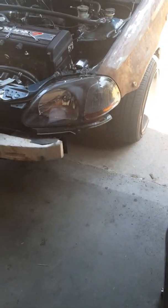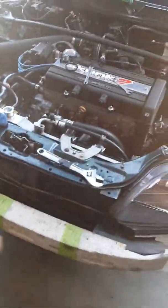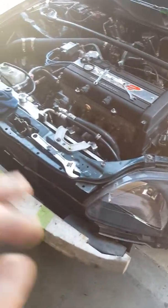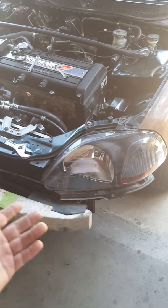So this car is in California — we have to have our cars BAR'd or do a hot smog. This car is actually BAR'd through California. They changed the laws a long time ago when they found out you can use all the B18B components from an LS for a B20. The trick is on 96 to 2000 — you have to use a crank position sensor, so you change to an OBD2 and up oil pump off an LS or B20.